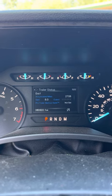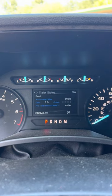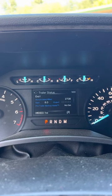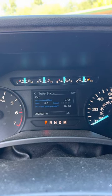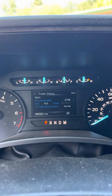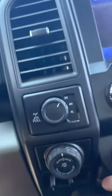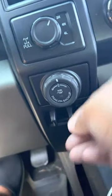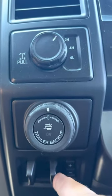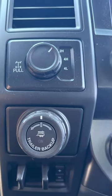When you begin to tow, you need to make sure that you test within the first thousand feet of pulling out of your campsite or parking lot. The way you test is at about 10 miles per hour — you stop the rig with your electric brake system by simply pulling your knob. Once everything seems fine, you are safe to tow.